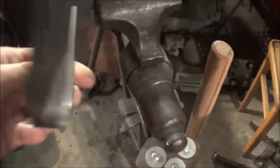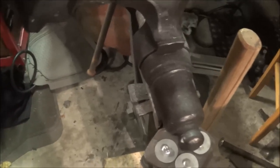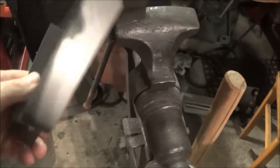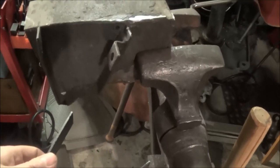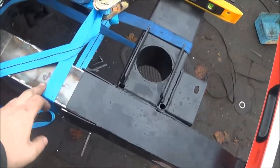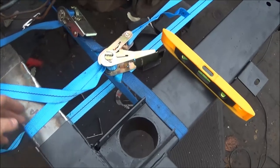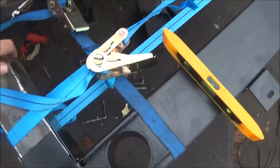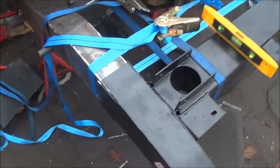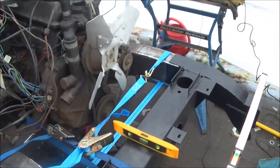So I've made four new stiffeners — as you can see, a reasonably similar match to what was there, so I'll weld these on instead. I've positioned the new member in place. These parts are fully welded but still tacked here — I had to pull them in because there's quite a lot of splay on them. I'm going to weld the inside first to pull them in. I've checked all dimensions and it all works fine, so the next job is to take the paint off, tack these up, and then fully weld it all up once I've got more gas for the welder.